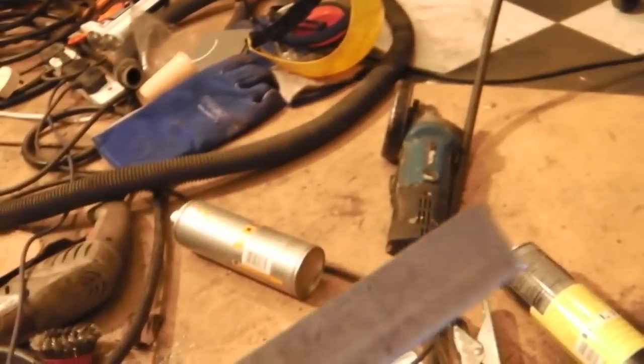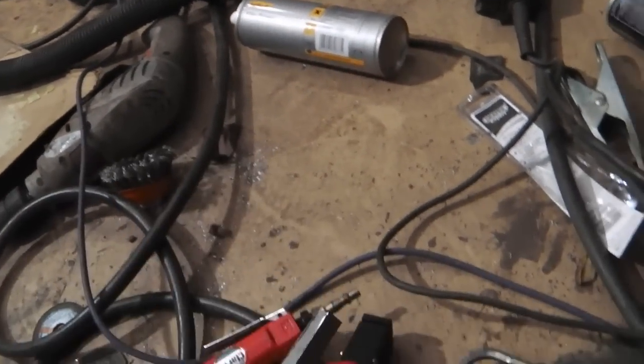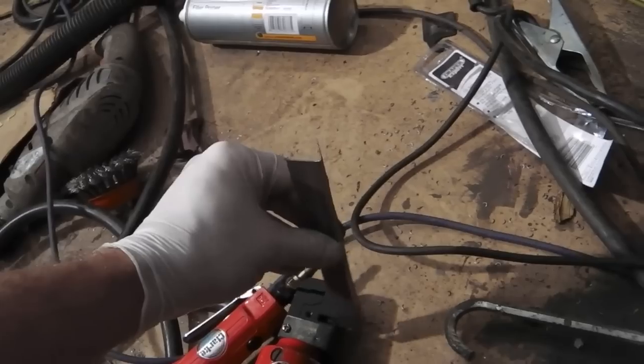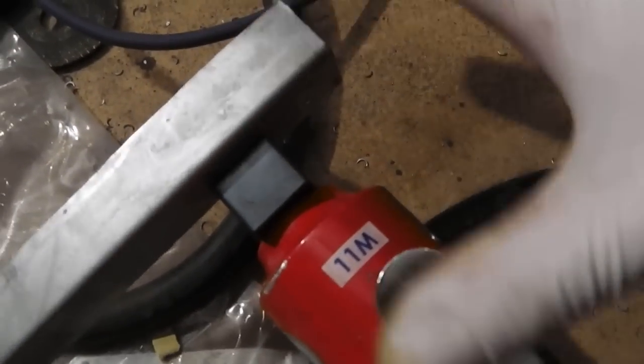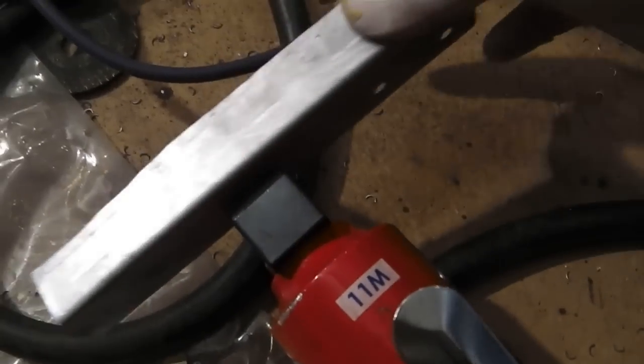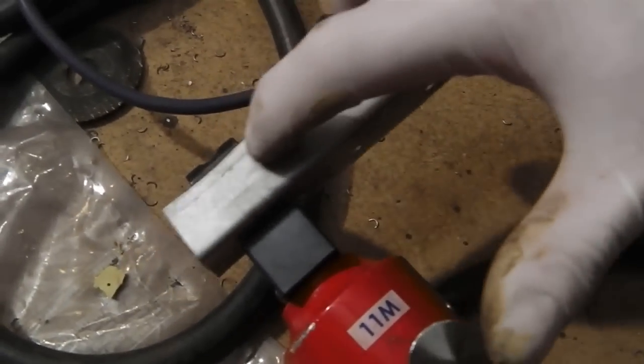We're going to punch some holes in it with the new tool. We've got a hole punch here, which is very handy, makes light work of stuff like this. So we'll get that ready and get the welder fired up, get that fitted. Just punching the repair panel, away we go. As you can see, you get your nice weld holes there. Good to go.